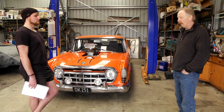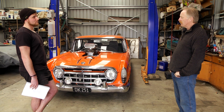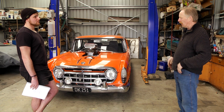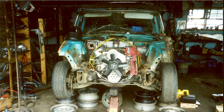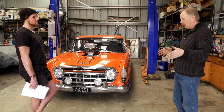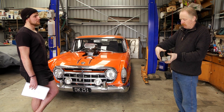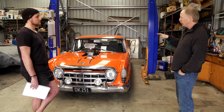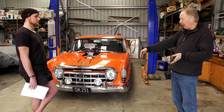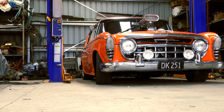There was another car I had at the time — a Toyota Crown. The floor pan was about the right size. I started playing around with that and found the HQ Holden front end and the Crown came to about the right length for the wheelbase. So we brought them together and welded it as one: Toyota Crown back chassis and HQ Holden front chassis welded together with some beams through the centre to strengthen it. Then we put the floor pan of the Crown back on and lowered the body right down over it so the car was low to the ground but still had original suspension travel.